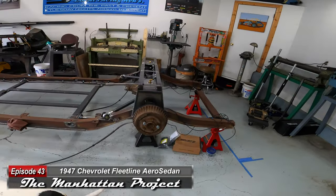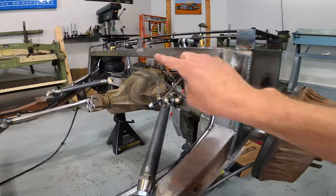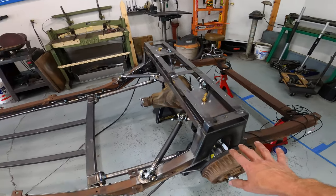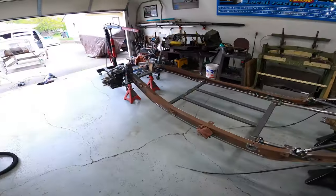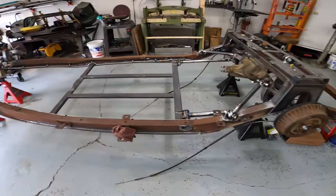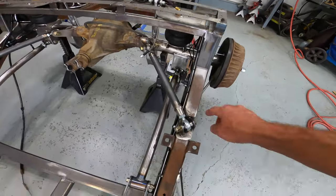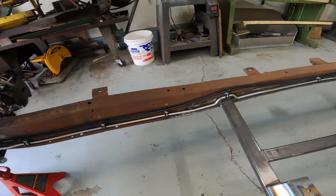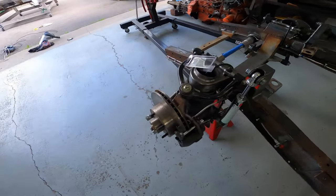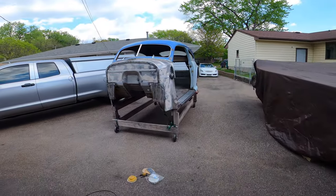Back out in the shop, giving a little update. Got the frame all back together, flipped it upside down, finished the inside of the c-notches, did all the finish welding on the bridge here and some finish welding up front. Did all the little details, got it back right side up, put all the suspension back together. Got the fuel lines, air lines, brake lines everything connected back up. The ride height sensors and ride height sensor wiring are all installed permanently. Just waiting on the body, so I got the body back on the dolly.